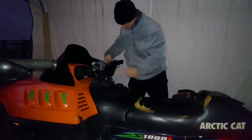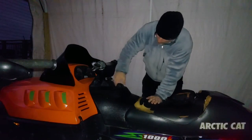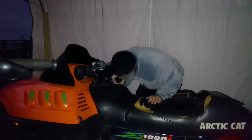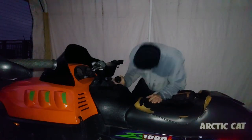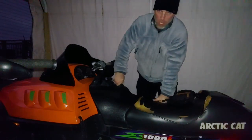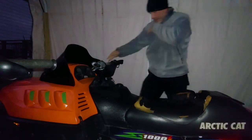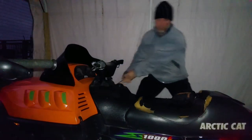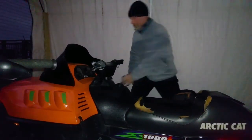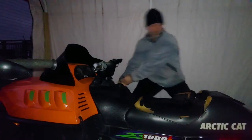Let's just go ahead and give this one a blow too. Yeah, so I'll just fill my lungs up, blow in there as hard as I can, and then pinch my lips off and hold it, and it pressurizes the tank and pushes fuel up. Alright, so choke's on. I keep my emergency switch off, key on, and then I pull it over a few times. Oh my gosh, dude. Totally different than a 440. Alright, baby, come on.